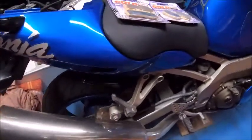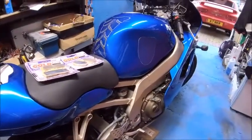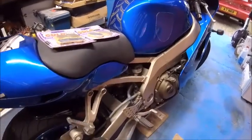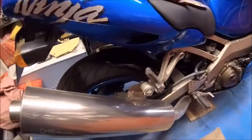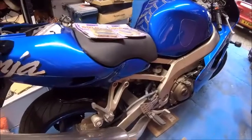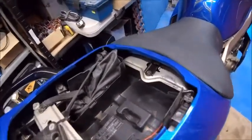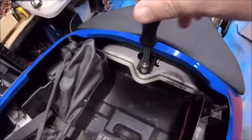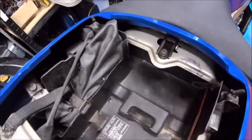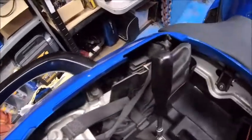Right, as I said, I've got the bike in the middle of the garage. First job is to change the brake fluid as well, so I'm going to suck all the brake fluid out with a little tool of mine. To get to that I've got to take the seat off, we shall see. So I'm going to drain the whole rear brake fluid system, change the pads, replace the fluid, and then start on the front - could be a bit of a long day this. For those that have never taken the seat off one of these before, it is dead easy - one 10mm screw in there.